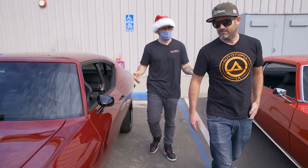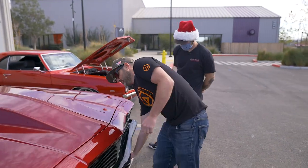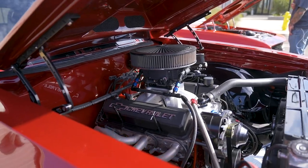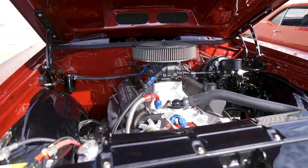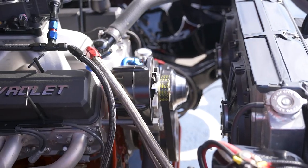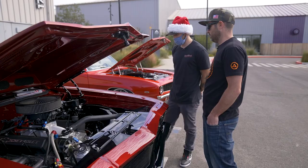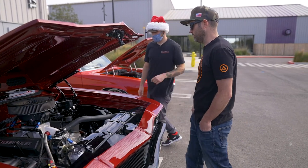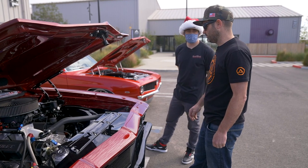Let's look under the hood — you said 685 to 700 horsepower. When you first look, it just looks like a normal small block, which it is, but it's actually a 454 cubic inch small block — not a big block. It's a Motown block designed for large cubic inch: four-and-a-quarter bore, four-inch stroke, true 454. It's got big heads and a big intake — a Super Victor — and cylinder head builder Tony Mamo fully ported and polished the inside of that manifold to match the heads.